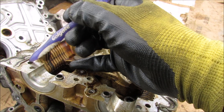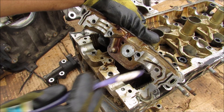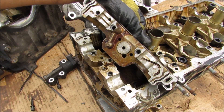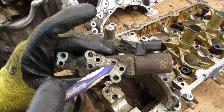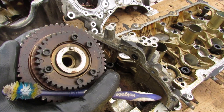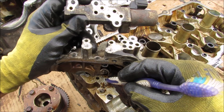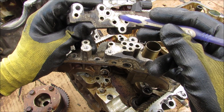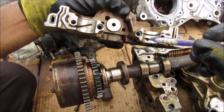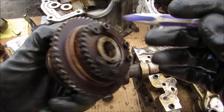The side-to-side galley also feeds the camshaft bearings — there's a hole that draws oil into the camshaft bearing, and similarly as the galley progresses to the next one there's an additional hole feeding that camshaft bearing. This little track takes oil from this hole to lubricate the exhaust cam, and similarly oil is fed through this track to lubricate the intake cam. The variable valve timing solenoid controls the amount of oil pressure that flows from inlet to outlet into the VVT gear so it can change timing between the crankshaft input on the outside and the camshaft output bolted inside. The most important hole comes from the head up into the middle of the VVT solenoid and back down through this hole into the VVT gear. The camshaft itself is hollow, allowing oil to flow from the VVTi solenoid cap into the camshaft and through holes inside it into the VVTi gear to activate it.